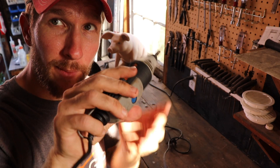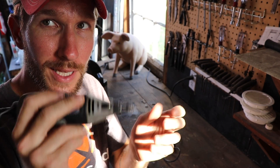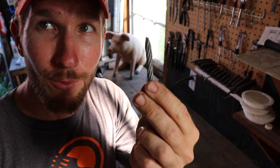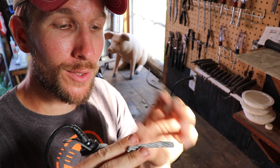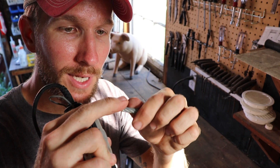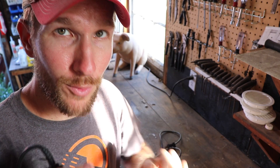Now that the super glue is set, I'm going to use my Dremel — this little fine-tune thing with a little cutting bit that lets you free-form sculpt things — and I'm going to cut out a little trench. The winner of what I should put in there to make it solid is a little piece of braided wire, little aircraft cable. Why would I use this? It's metal. It's very durable. And with all the little grooves, if I pour this whole thing full of epoxy, it's going to sit and nestle into the piece of plastic, and all that epoxy is going to go into that metal and just fuse together and become one. I'm going to sand the edge down real quick and make sure everything fits nice. This will make it a really solid handle.